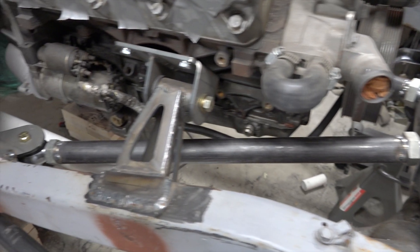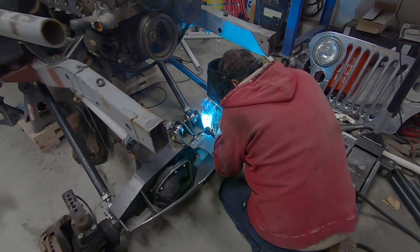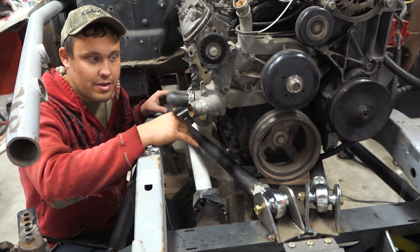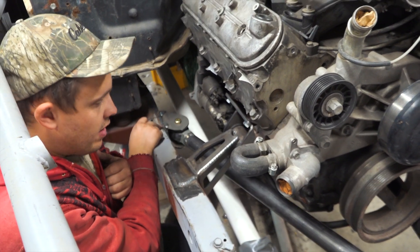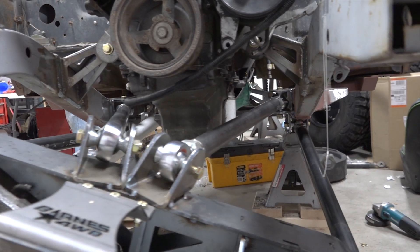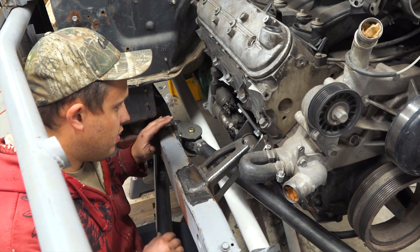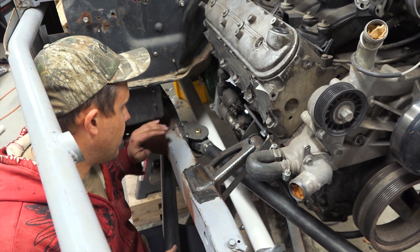After doing our lowers, we came up to the top and angled our upper mounts on the axle side straight out to where they needed to be, centered on the axle — those were honestly really easy to locate. When we did the math on 75 percent for the upper link length, we had a couple of limitations: there are plates welded on for frame stiffening. Going in front of them would put us quite a bit shorter than 75 percent, and going behind and on top puts us a little over 75 percent. I chose to go over instead of under. We also tried to work within the parameters of having some frame-side link separation — we've got about four to four and a half inches, and I think that's going to be okay.